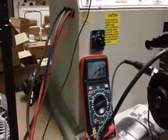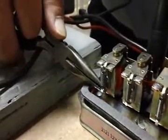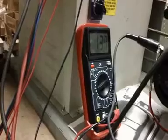On this back side here on the generator field coil side with the spring load. On the bottom here you want to take your needle nose and apply a small amount of pressure downwards. You can see our voltage starting to rise. We want to get it up about 14.3, 14.4.